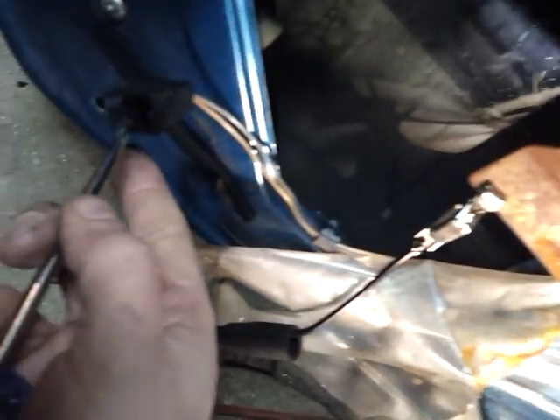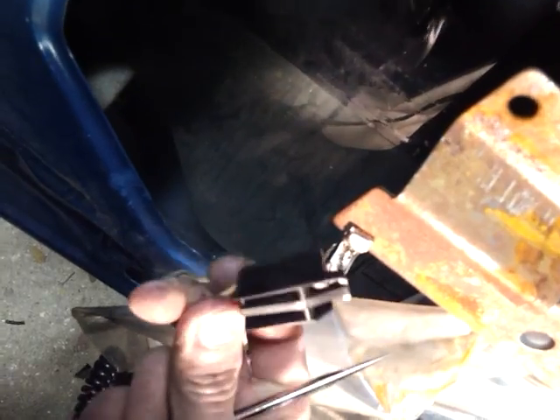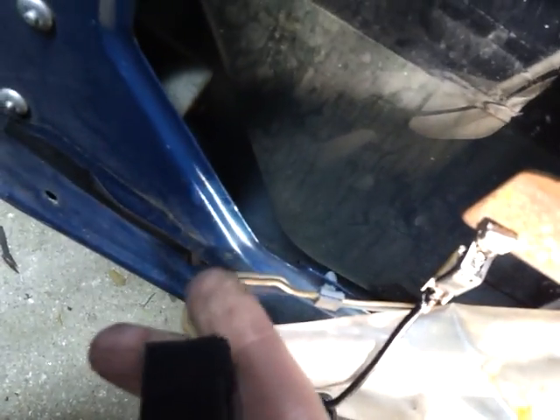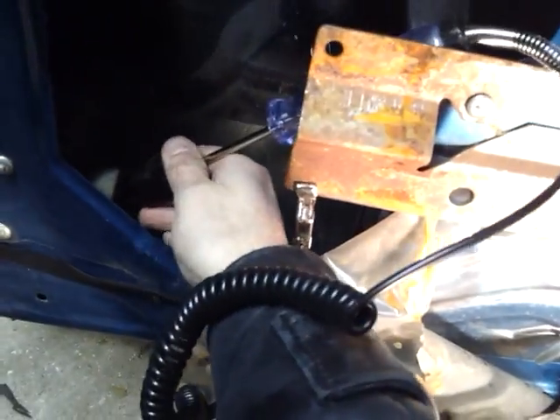You should have power when you hit the lock. Relay is back in — let's do this. Yay! Now if you hit unlock — remember, like I said, polarity gets reversed. You hit the tan wire and double check that. If it doesn't unlock, this could be your culprit too. The tan wire is the one on the left. So let me stick it in the hole and test the unlock position. Now I'm going to hit unlock. Yay! It works! Hooray!